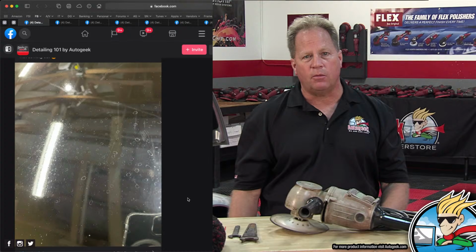But to me, that looks like something a quality compound and maybe a microfiber pad could fix, on something like the Meguiar's or one of the Beast tools, a gear-driven tool or a rotary. Would you suggest trying a water spot remover? There are some good water spot removers out there, but even if they remove the visual appearance of the spot, that surface is still going to need to be mechanically polished to get it right. So you might as well just go right to the mechanical polish.